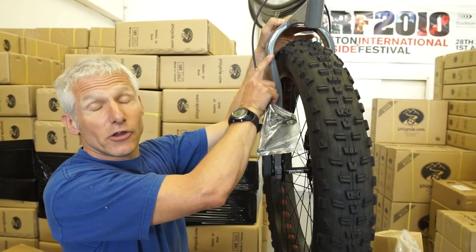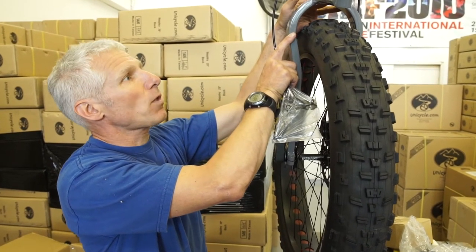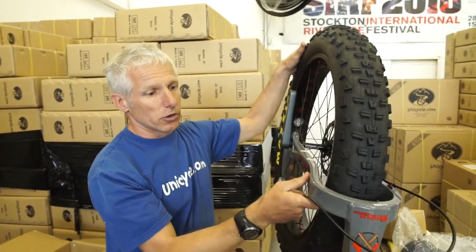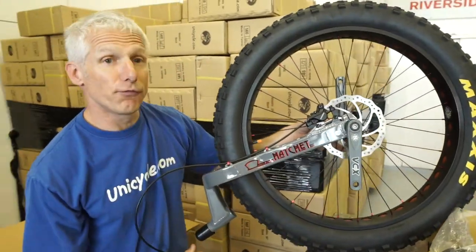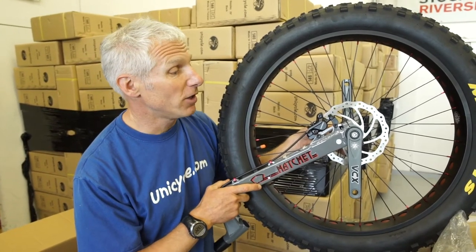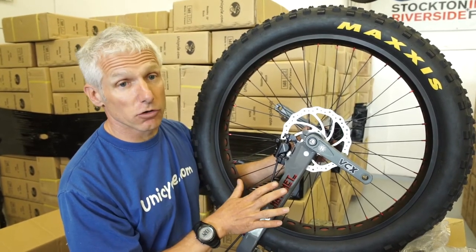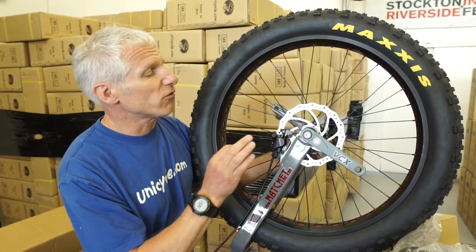This frame will actually take a five and a quarter tyre. We've been prototyping it with five and a quarter, and Josh in the US has been testing it in the snow and it works fantastically. There's enough clearance. If we look at the changes in this product from the previous versions, the first thing you will see next to the tyre and the rim is new cranks. These cranks are the VCX — a ground-up build from nothing, the development on from the Venture 2 cranks. We needed a new billet, so we redesigned it.